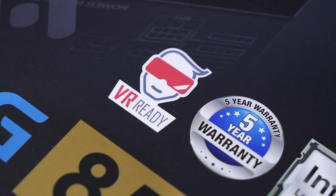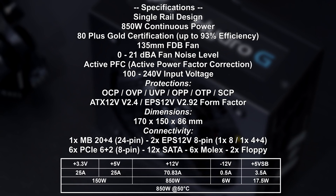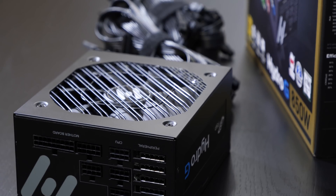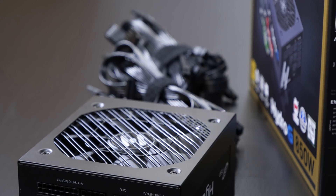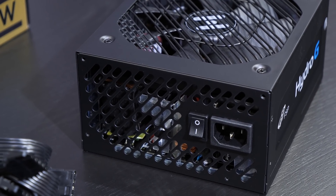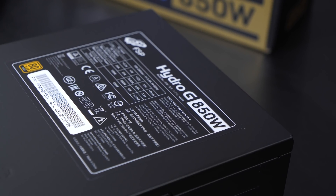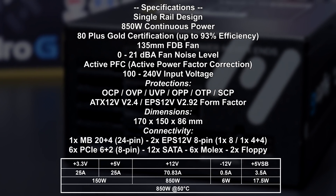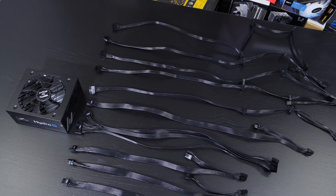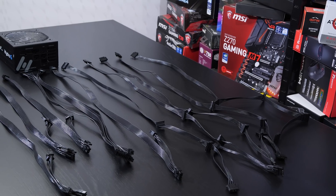Speaking of gimmick, I find it amusing it says 'VR ready' on the box. FSP decided to go for a single rail design here, so there's only a single +12V rail. Opinions divide on what's actually better — single or multi rail. Objectively, high quality multi-rail units tend to offer slightly better OCP protection, and the overcurrent protection is often faster and more reliable. But as a user of single rail PSUs for many years, I've never had issues as long as you go for quality. Either way, we're talking definite 80 Plus Gold with a rated efficiency of up to 93%. The usual protections are all featured here, and in terms of connectivity there's a lot — including a second 8-pin CPU connector in the form of 4+4, which could potentially help with overclocking.